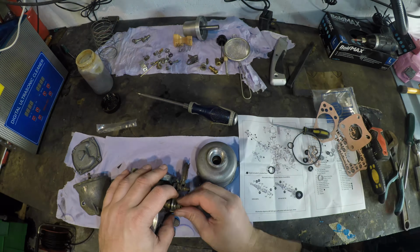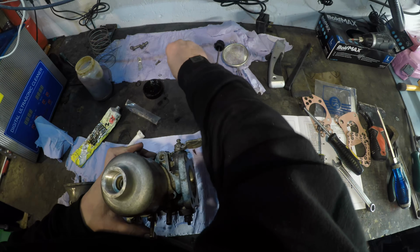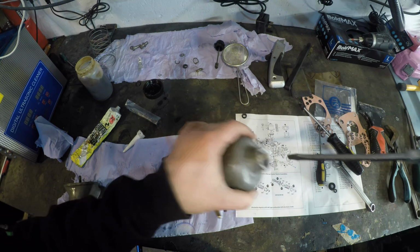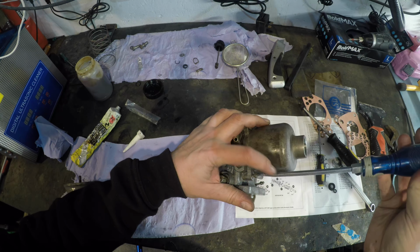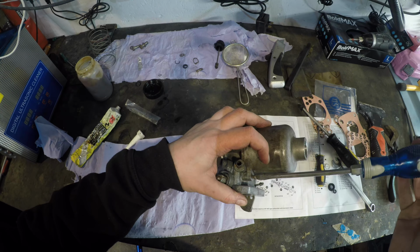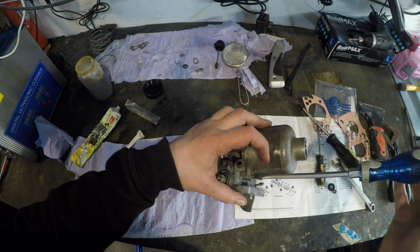Okay, so we've got three of those. Now, you might be wondering why I'm turning it the wrong way to start with. That's quite simple. With aluminium especially, and plastic, you've got to be careful with these coarser threads. What I'm doing here is finding the thread. There, see? It's lined up perfectly. So it reduces the risk of cross-threading significantly. It's a good little trick.